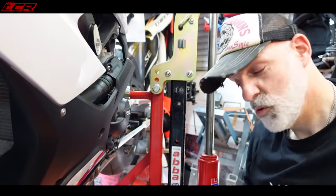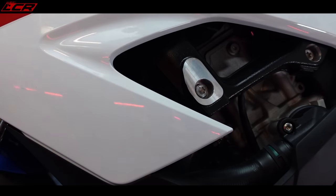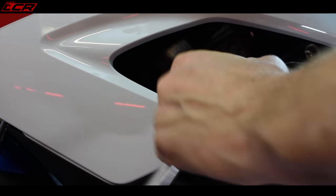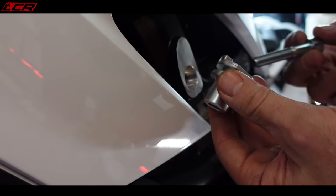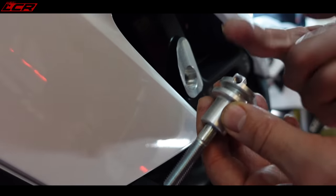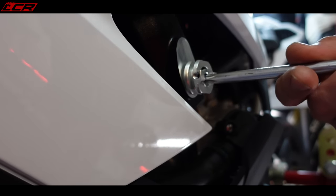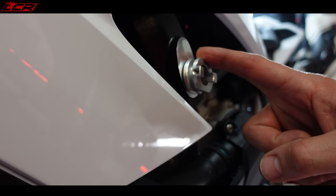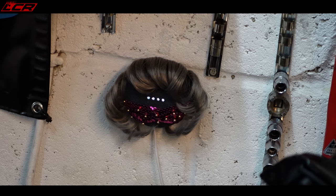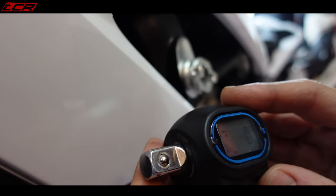Let us put them on. Working on this side of the bike, I'm going to take the engine bolt out, put the puck on, and it's going to look pucker. Take the standard engine mount out, put the new engine mount that comes with the kit - the inner piece - in. You see the little threaded section there? Get that pointing outwards because the puck screws onto that. Mavis, what's the torque setting for the main engine bolt on the S1000RR? That's 40Nm. 40Nm - thank you, Mavis.